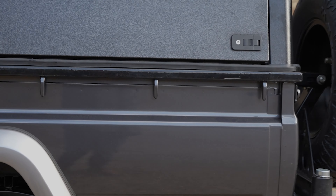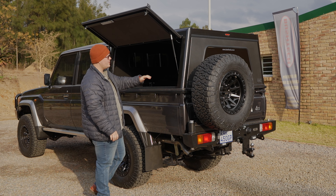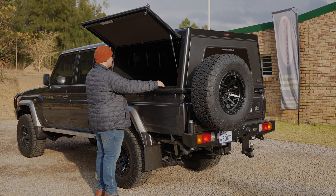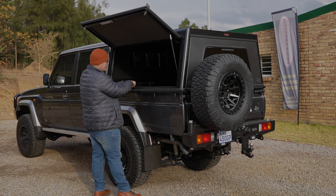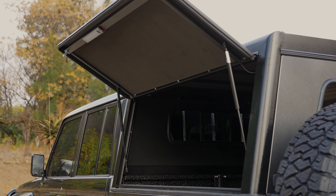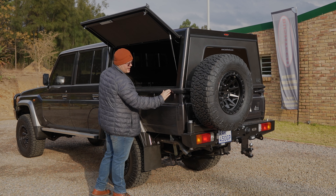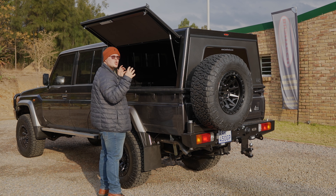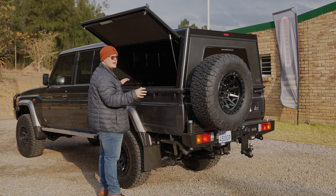There we go — we've got the canopy on and we've got the dust seal kit done. It looks beautiful. We've gone for the textured black frame and the hammer-out doors and it's really nice. One of the things with the canopy — especially on your side doors, it's a very high-use space — Bush Tech put a pinch weld around the frame of the door and have the dust seal on the door itself, so you're not damaging the seal from use. We're also sitting on a very special base rubber designed to absorb a lot of vibration and flex in the chassis, making sure the canopy does not crack from use off-road on corrugations. That is why Bush Tech can actually offer a 10-year guarantee on the frame — something very unique in the market.